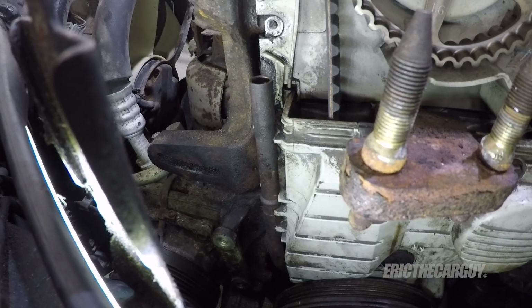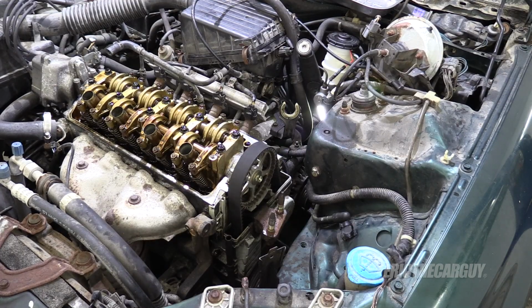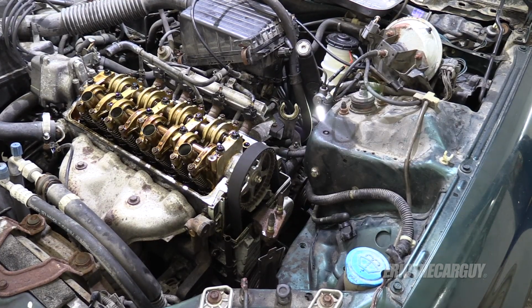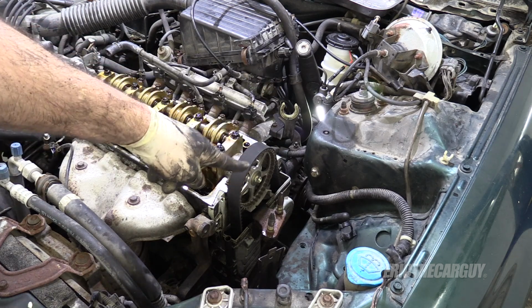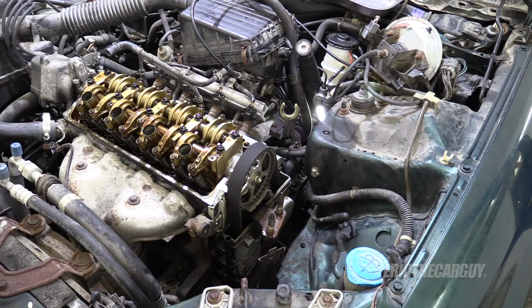Now for some drive belts, starting with the alternator. All right, I remove my crank tool or my ratchet and stuff. Yeah, don't start the engine with those attached. Now that the alternator is loose from its mount, that 14 underneath that we first loosened was one of them, and then this 12 up top off the water pump was another one.